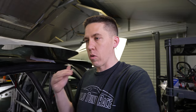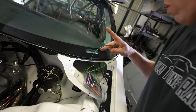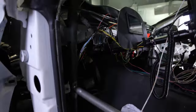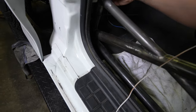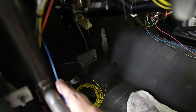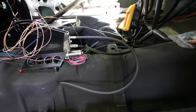This doesn't have that constant-on wire, which is some of what I've got to figure out once I turn it on. Once we get the race pack fired up I'll know better. I ended up stealing the horn wire up front for the headlight running wire, and I'm going to use the wiper brake switch wire for a horn and mount the horn up in there, because it's a street car. I also put a power window box in this car with the switch that'll eventually get mounted here, and I've got the air shift button to figure out placement for.